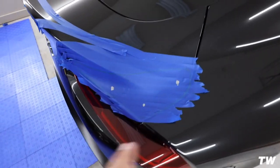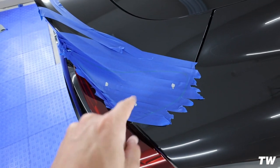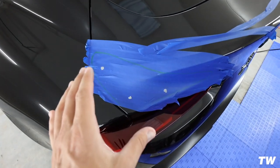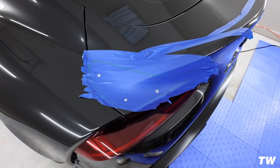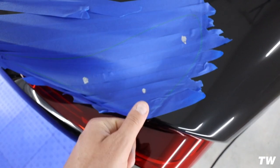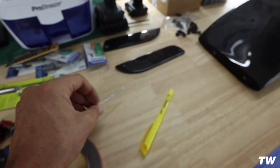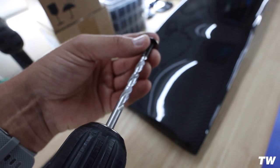When drilling and making these line up with those holes, it's going to be tough — it's not going to be perfect. Just be prepared that when you drill these out you might have to kind of open things up a little bit and use some adjustability to make everything come together. You want to make sure that everything looks even on each side. The scary part about drilling into your trunk — one shot. If I ever decided I wasn't going to run the wing again, I'd just make two little paint-matched pieces to cover the holes, and this would get covered up by a carbon fiber trunk lid spoiler. Start with a smaller bit and then open it up — just want to make sure the bit is a tad bit larger than the actual screw.